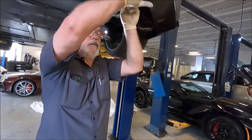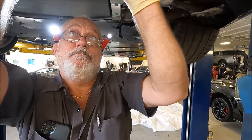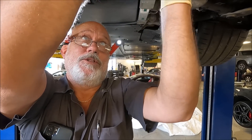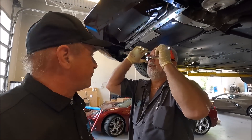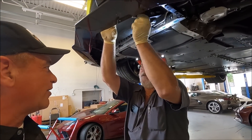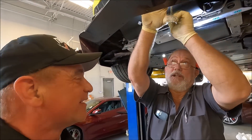There's a number four down there — it says either/or for the transmission fluid flush. A lot of people get hung up on that because they lose track of the time. Three years goes by pretty quick, especially in a Corvette. When the 2020s first came out you had one year, then they switched to two years, now they're upping it to three years. The question is: does that three-year interval apply to a first service, or to a transmission flush? We're not quite sure if they're going to change that interval, but we'll keep you updated.